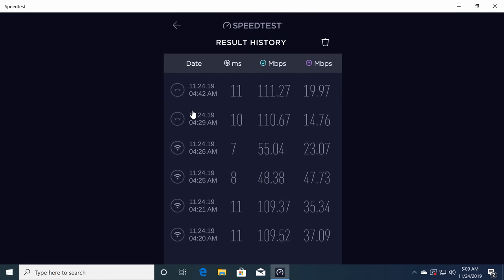Next, I have the results of the Wi-Fi speed test. The results show the 5 GHz and the LAN port hitting the maximum speed of 100 Mbps. The 2.4 could only manage around 51 Mbps. The 2.4 Wi-Fi band delivers 54% less bandwidth than the 5 GHz, and I recommend using the 5 GHz and the LAN port for maximum bandwidth speed.